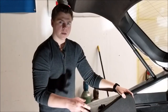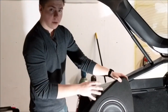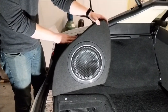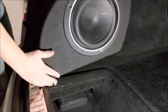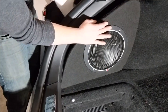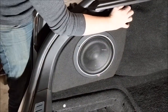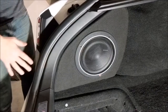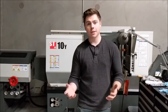Now that we have the amp installed underneath the sub and all the wiring running from the front to the amp, we're now going to install the sub. The sub has grip tape on the back, and that's going to allow it to adhere incredibly well to the carpeting of the car. There's also a block underneath, so you're going to have to rotate the sub in, get the block or the support bar, and firmly push the sub into place. Give it a good tug and make sure that it's not going to go anywhere. Now you're done. Thank you for watching the Tesla Model S Sub Kit Install by BA DesignWorks — I'm Brody. If you have any more questions, our link to our website is in the description below.